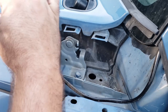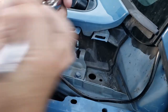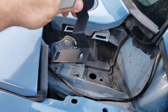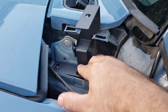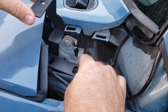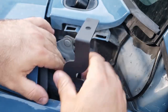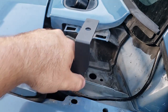Remove the two bolts holding the hood — fairly straightforward, but be careful not to hit the glass with your wrench or hit your A-pillar. You can see it does not sit flat. I thought maybe I was installing it backwards — that doesn't work either. The only way the other bracket orientation could work is if you actually cut the cowl itself, so that is not an option.